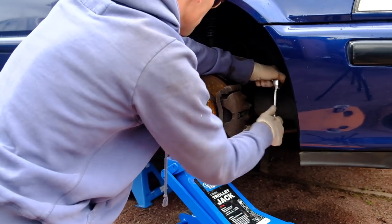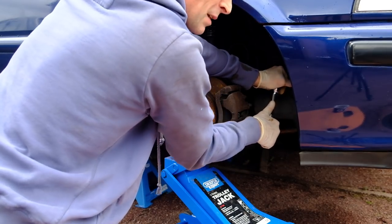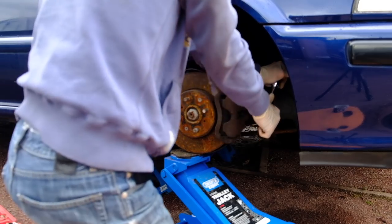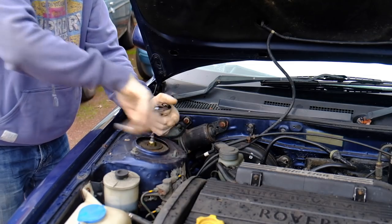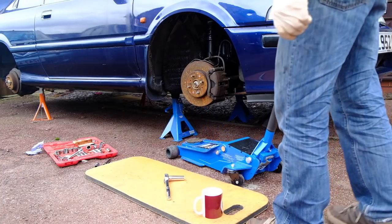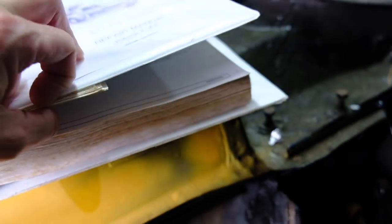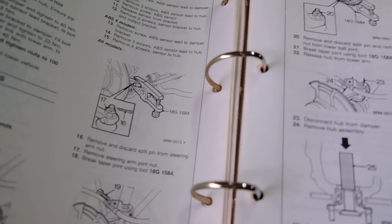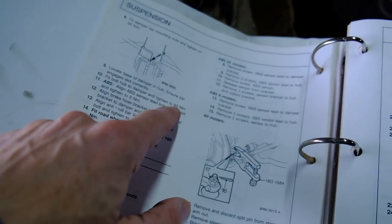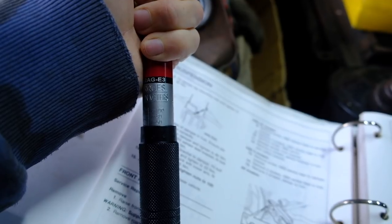The other thing I need to be doing is setting all these things up, because at the moment they're not set up at all. Hopefully they're all set up roughly in the middle. Then I'm going to get the MOT done so I can drive it and then fine-tune them all. I've got the actual workshop manual for the Rover 200 and 400 series — it tells me I need to tighten the hub to damper pinch bolt to 80 Newton metres and the drop link to 45 Newton metres. Very handy. That's a lot of ugadugas.